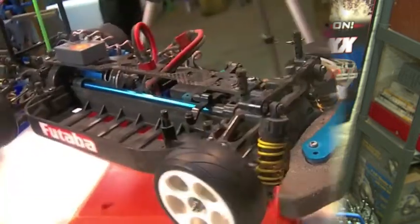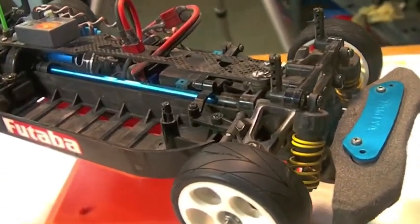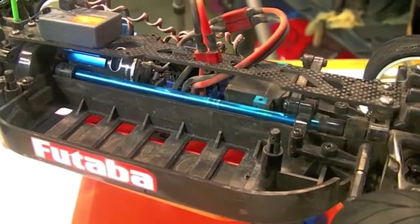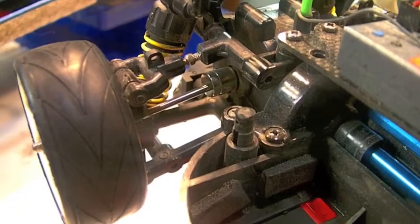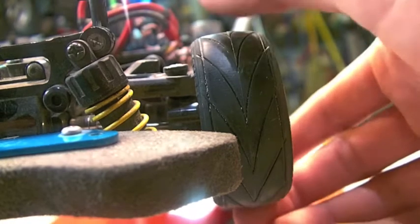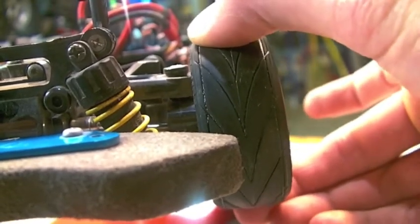it could be. Make sure there is no debris like small twigs or grass or stones wedged within the external drivetrain components like the center drive shaft, dog bones going to the wheels, or pinion and spur gears. Over time, ball bearings will wear out and need to be replaced. You can tell if your ball bearings are worn out by moving your tire back and forth and seeing how much slop is in the bearing itself.